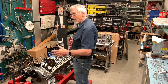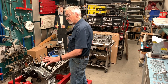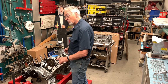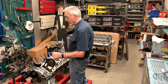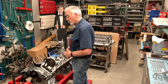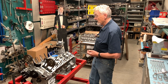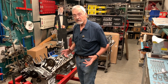We're going to set it on and get it to the point where we're at the top of the studs, with the timing chain and gears coming up through the cylinder head. Then we've got to start working around the studs, making sure we're close to begin with. We don't want to be way off and have the studs grinding away in the bottom of the head. We're going to start out with the B-side — that first head right there is the B-head — it's just the way it worked out.